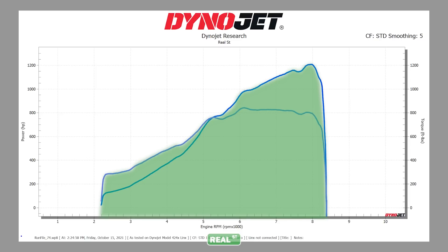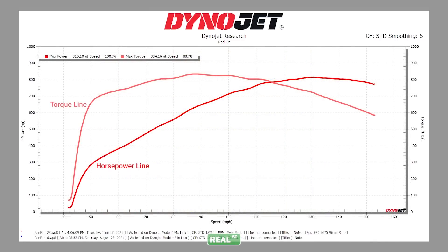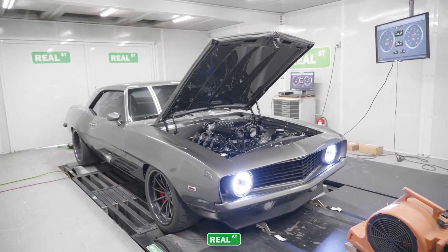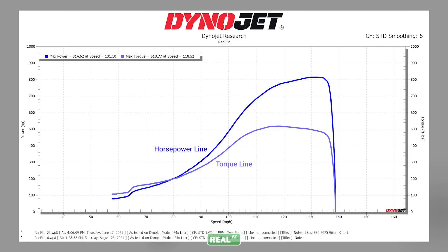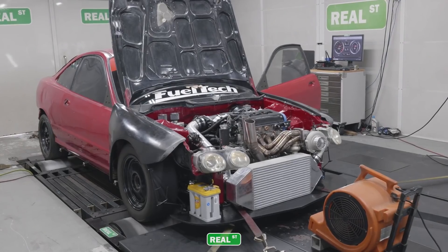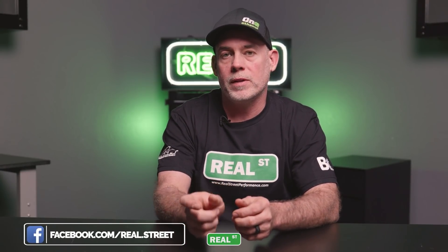If you imagine the area under the curve shaded a different color, the bigger that shaded area, the more overall power the engine makes. Dividing the graph into three columns gives you low-end power on the left, mid-range in the middle, and top-end power on the right. Here's a dyno graph from a big, responsive engine — a 440-inch supercharged LS — that comes into power hard as soon as it goes wide open throttle and carries that power all the way to the end of the gear. The next graph is a small B-series engine with a large 67mm turbocharger, so it experiences a lot of turbo lag down low but ultimately achieves roughly the same peak power. Both engines read roughly the same peak power number, but how they make that power is completely different — going off just the peak number means you miss a lot of valuable information.